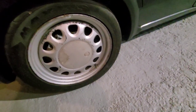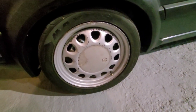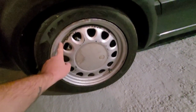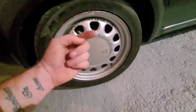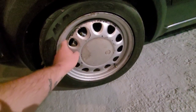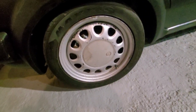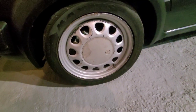They're just going to get a good clean up, get a bit of Scotch-Brite on there, rub them all down, get those weights off the front because they look disgusting, I want the weights on the back. Once it's all done and clear coated, I will then get some clear silicone and seal around there so nothing gets in there. But also prior to primer or anything, that bottle of Por-15 metal prep I showed you in the garage - I'll just pour some of that around there, not a lot, just there, and get in there with a sharp pointy tool to get as much corrosion out as you can. Then once it's all painted and primered, a thin bit of silicone around there - you won't notice it - just keep the corrosion at bay and they'll be nice and tidy.